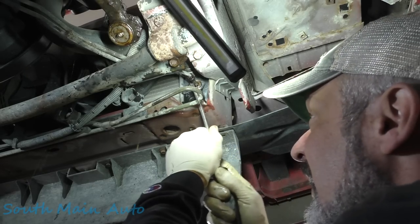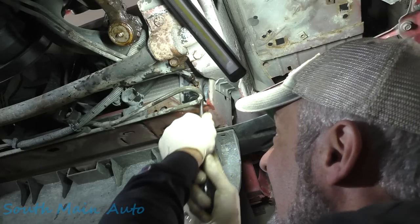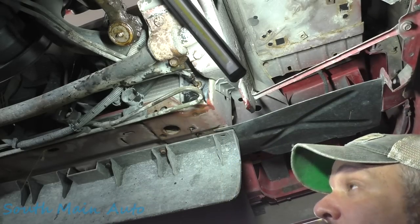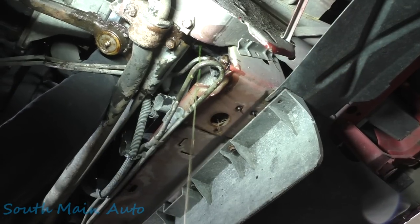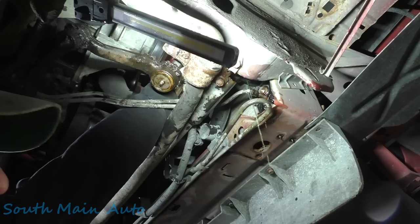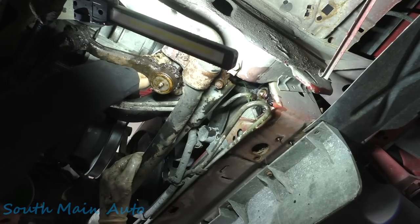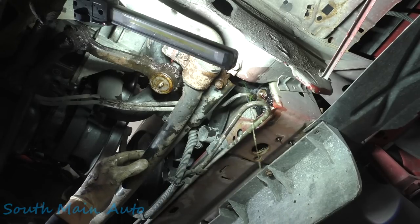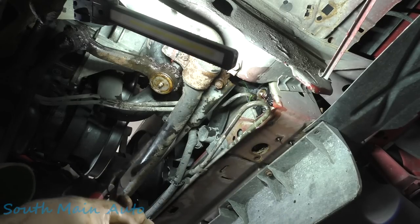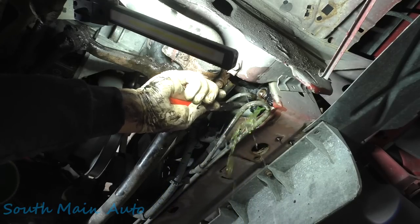I believe it is loose. Yeah. It's a plastic radiator, so it shouldn't be too corroded or stuck. I think we can probably pull that. Make sure you got your bucket somewhat ready here, just in case. Oh, gotta move you folks. I'm gonna freeze on you if we don't. There we go. Not too bad. Not bad at all. Okay, we'll stick that hose out of the way. Pull that petcock back out of there. Whoa! Yeah, see the squirter.